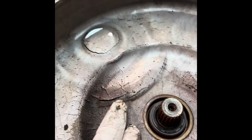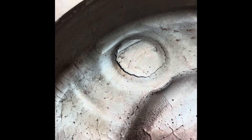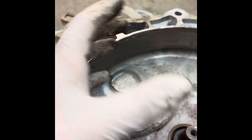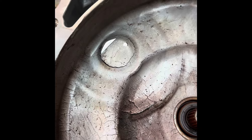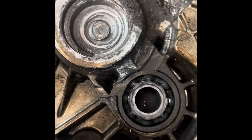Here is the first thing we see: the gear has started to push through the case — it actually broke through. So we're going to need to replace this case cover. You can see here this is probably why it didn't run, because that bearing has shifted down in there. That is the worst one I've seen yet. Let's keep going.